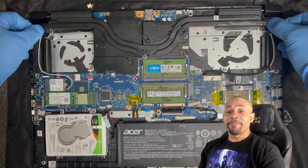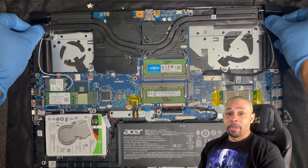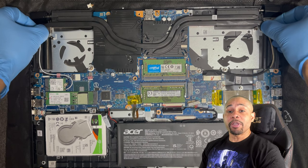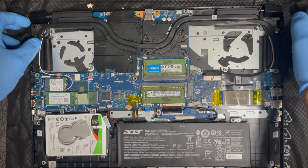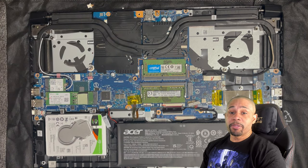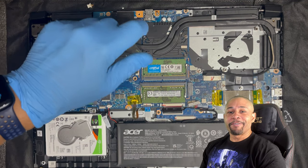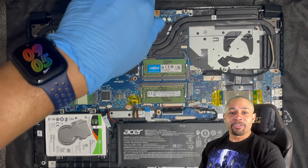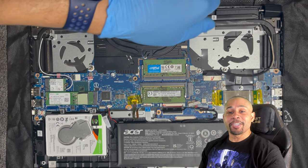The heatsink will feel slightly lifted, and that's because of the K5 Pro. Don't push down, but instead replace the screws, which will slowly push down the heatsink into its proper place when turned. You can replace the screws by the numbers on the heatsink, or you can put the screws in randomly. I usually make a few passes when putting the screws back in. The first pass is just to get the screws started, and the second pass, and most likely the third, is just to tighten everything down.